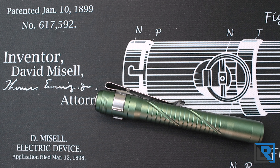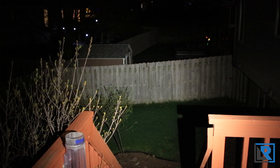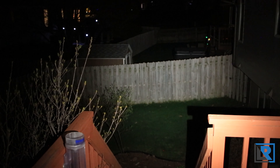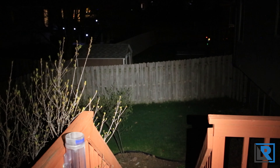Output on the Nichia model I have here is rated at half a lumen, 15 lumens, 60 lumens, and 180 lumens. Here is the Royvon Aurora A33 running that Nichia 219C LED at about 5000 Kelvin, 90 CRI. On the half-lumen moonlight mode, bumping up to low mode at 12 lumens you can see the beam shape out of the TIR optic nicely — nice high CRI. Here is medium at 50 lumens, and we can see it throws out and hits my normal fence no problem. Last is high at 180 lumens. It will hold this for one hour, which holds out in my runtime test. Nice high CRI tint — this is what you want in an affordable pen light.